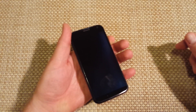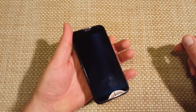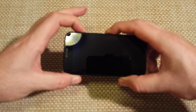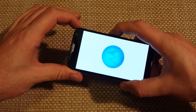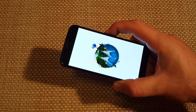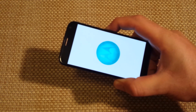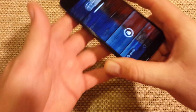This is a quick informational video on how to put your Motorola or Moto X into safe mode. There are two ways to do so. First, press and hold the power key. Once you get the Motorola logo, let go of the power key and then press and hold the volume down button. Keep holding the volume down button — it might take a little bit of time. Once it boots up all the way, on the bottom left-hand corner of your screen it'll say 'Safe Mode'.